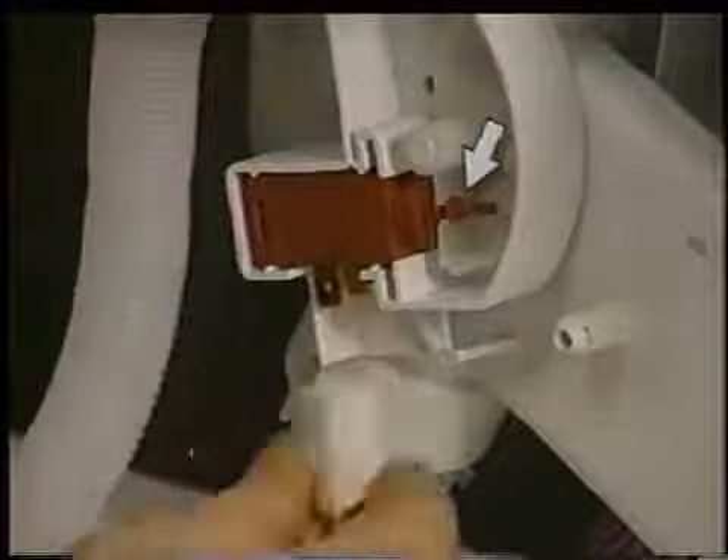The lower actuator is used to control the top rack wash feature and is only available on the SHU 6-Series dishwasher. To remove the actuator, remove the wire connector and then pry the actuator out from its housing. When replacing, make sure the actuator's arm is properly inserted back into the gate.